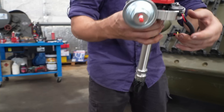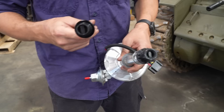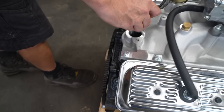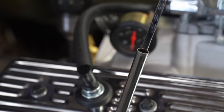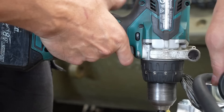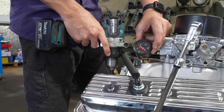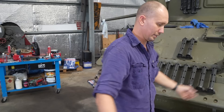That gear runs off the camshaft and drives the oil pump underneath. This is an oil pump drive primer and that goes in here like that. We're in the safe range now — hopefully going the right way — and we should see oil pressure build. Yes, we've got oil through the whole engine now. It's primed and ready to go.